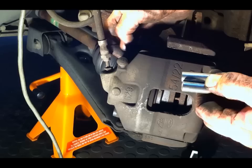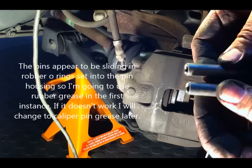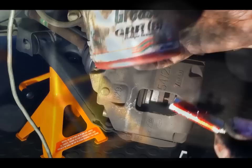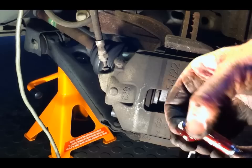I'm going to quickly get these onto the wire brush on the grinder and clean them up because there's a bit of corrosion on them. They're now nice and clean and shiny. They go into a rubber fitting, so these are actually sliding on rubber, so you need to use rubber grease — the red rubber grease, which is a high temperature, high melting point grease. Put a liberal coating of red rubber grease on these. If the brake caliper pins are not sliding in rubber, then you need to use a high temperature silicone grease, or you can actually buy brake caliper pin grease.